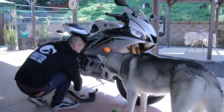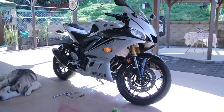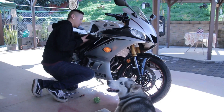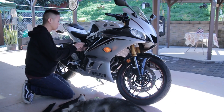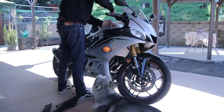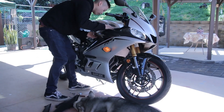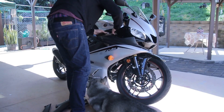I'm putting all the pins back just to be safe while loosening things, then started pulling the side fairing. There's a 10 millimeter bolt right there and a 10 millimeter up top as well. Start prying it off — don't forget there's a connector up there for the light.